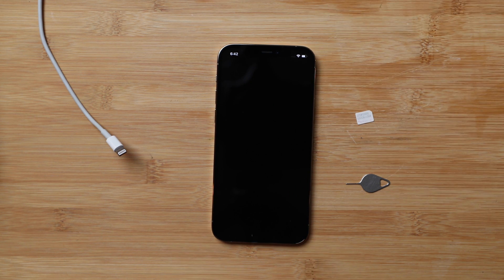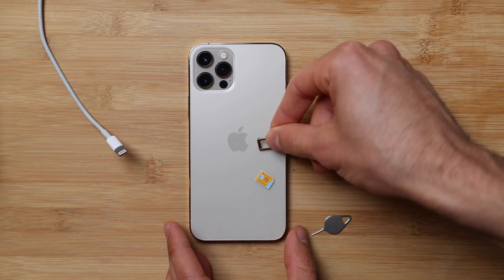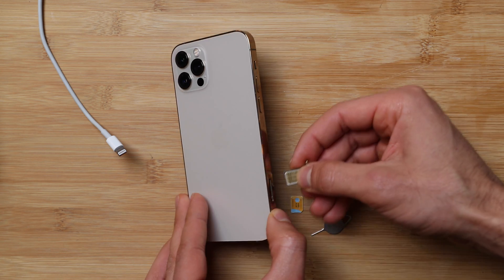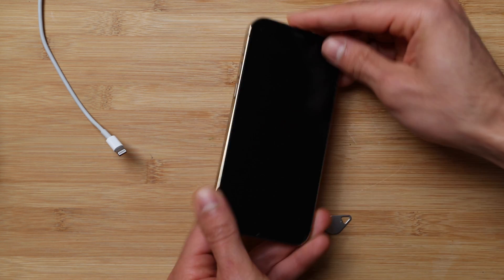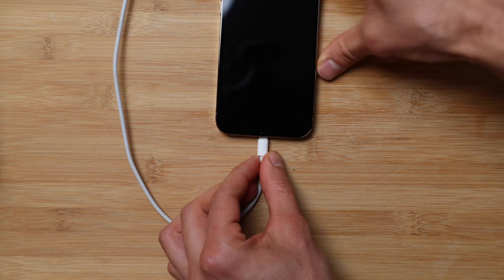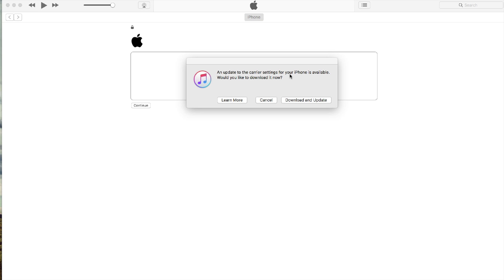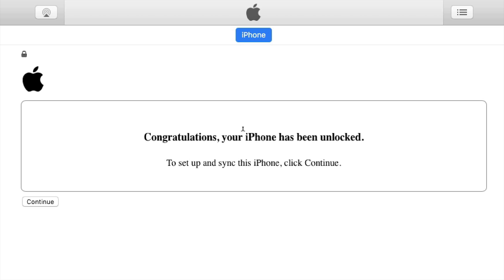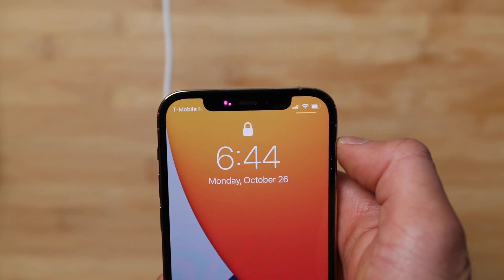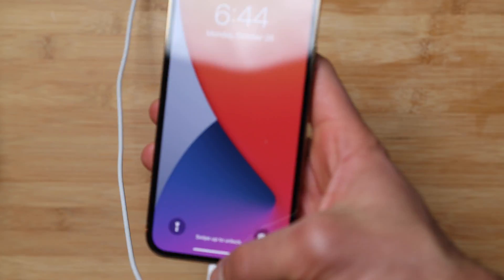To activate the unlock, we're going to connect the iPhone to the computer using a USB cable. The next step is to insert a SIM card from a different carrier — since my phone is locked to AT&T, I'm going to insert a T-Mobile SIM card. It can be any carrier, as long as it's different from the original. Make sure you have the latest version of iTunes — I'll include a download link in the description. We'll wait for iTunes to detect the connected iPhone, and we should get a message confirming the unlock. As you can see, my iPhone was locked to AT&T and it's now running on T-Mobile. My phone is now fully factory unlocked and will always remain unlocked.